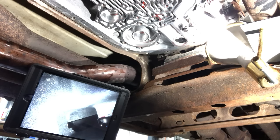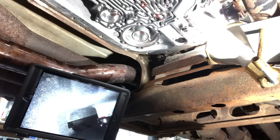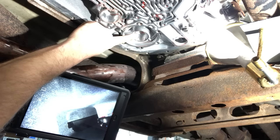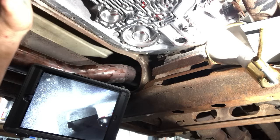When I get home I look up Sonnax's website — S-O-N-N-A-X. They have a sure gear kit and a little bit of a diagnosis on when reverse fails. I had all forward gears but did not have engine braking in manual low when you pulled the lever all the way down, which would suggest either the servo piston rod, the brake band, or possibly an electrical issue.